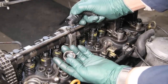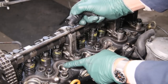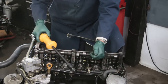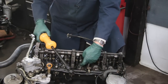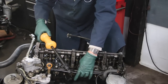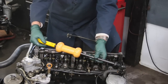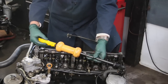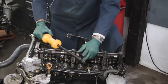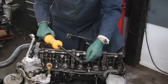The collar nut has to come out. Once the collar nut's out, the way you get the pre-chamber out is by use of a slide hammer. To remove the pre-chamber — once again, after you remove the collar nut and after you've removed the glow plug, double check to not forget the glow plugs — you're going to need a heavy slide hammer. This is a five pound slide hammer, probably the smallest one you'll want. You're going to need a special adapter with a very special threaded fitting that goes down into that pre-chamber.